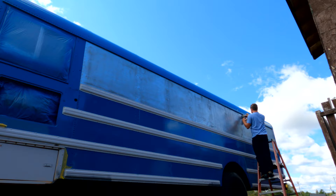You should see a perfect reflection, but you don't because it's orange-peeled a bit. I did everything I could to mitigate that, but there are spots that are really reflective the way I was hoping. It's almost automotive quality in some areas. There's a delicate balance between your thinners, paint pressure, air pressure, distance from the metal, conditions outside, how fast you can work, and your skill level — they all come together to determine the quality of your paint job. I thought using a paint gun we'd be able to get an automotive shine, a perfect gloss coating, but it just didn't level out the way I was hoping.